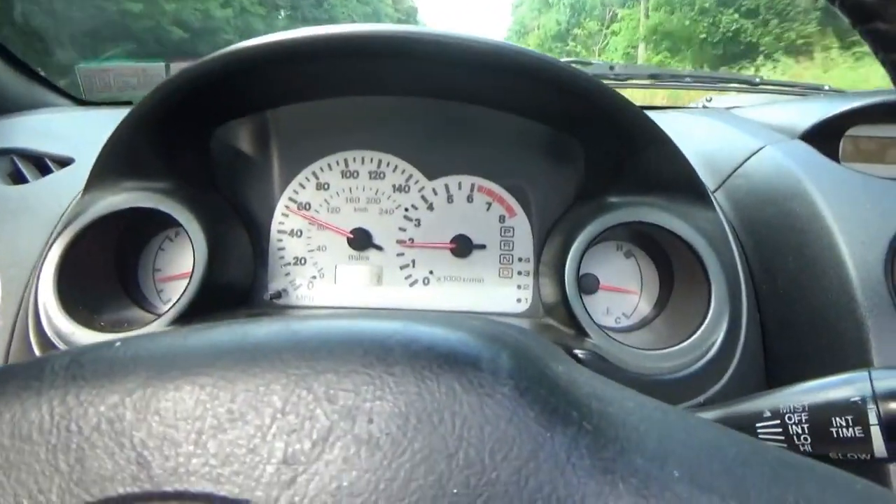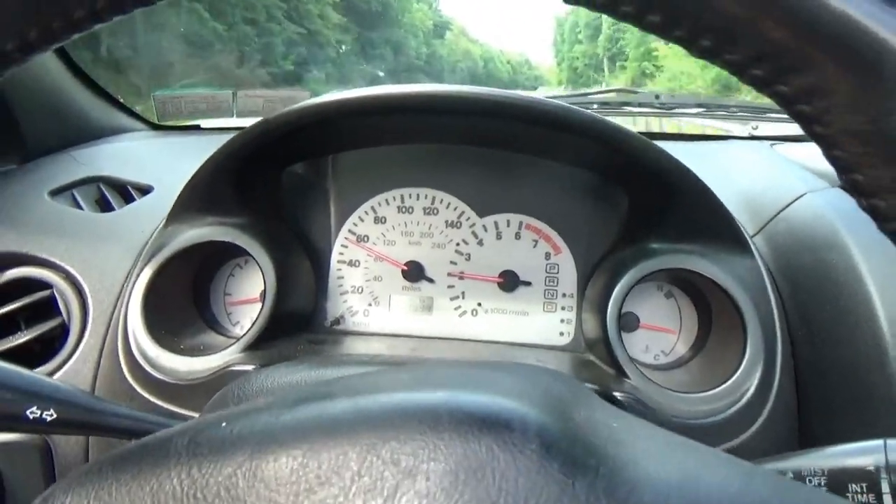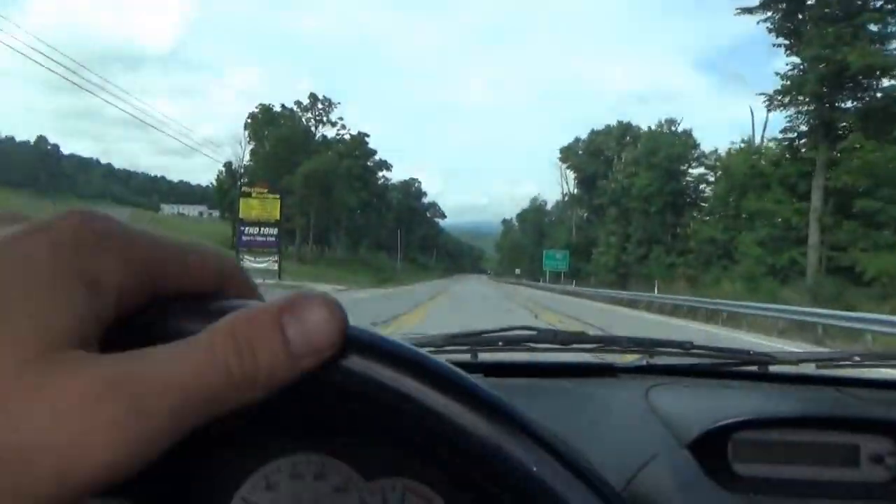Cruising over the top — car runs beautifully. I think it was just a loose negative battery terminal. It looks like it's been replaced before, and that nut that holds the wire down just wasn't as tight as it should be. At this point, give it back to the customer and let it go. Otherwise it runs perfect.